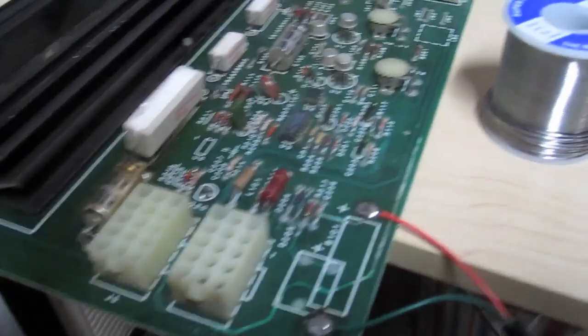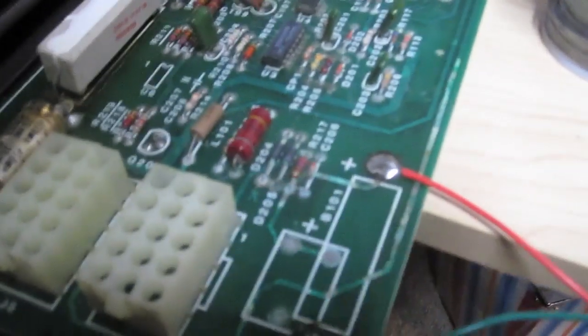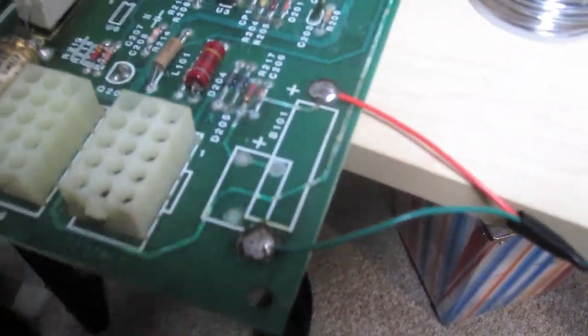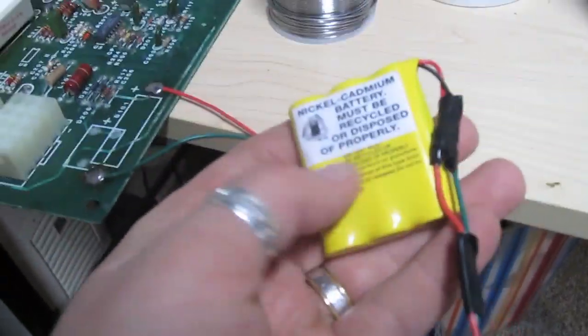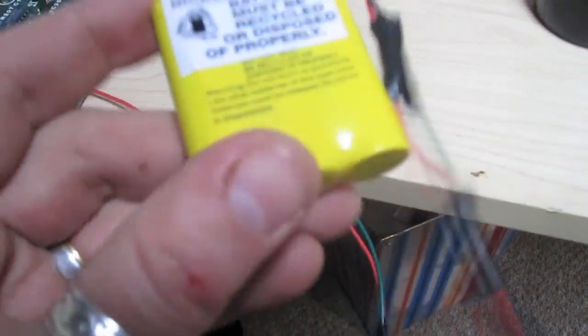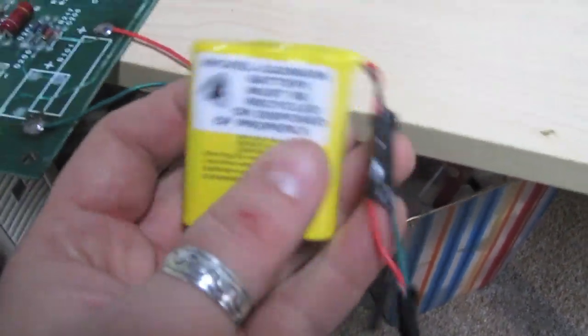We have the battery installed, and you can see I made the wire long enough so it can hang away from the power supply. Basically what you want to do is splice into the battery, positive to positive, negative to negative. On the MCR power supply, positive is labeled, and I just solder to these two leads. I didn't have any black wire so I used green for the ground — just keep your polarity straight. After you do this, you need to leave your game on for a good while — they say 14 hours — because you need to charge this battery. Once it's charged, it should maintain your high scores. I put one of these in my Tron and every now and then it loses the high scores, so I'm wondering if maybe I used too low a milliamp-per-hour battery. This one is 700, so we'll see.